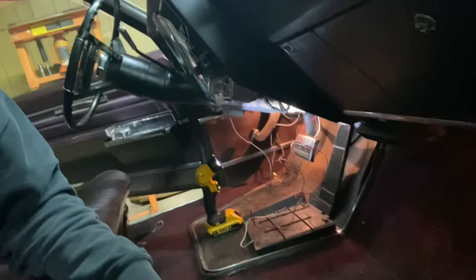All right, it took me two tries to do this because I tried using one of these little clippy doos, which work great sometimes, but they didn't work great for this. So we have a big spider nest of jerry-rig wire down there to jump it, and wow, that hood is massive and it shakes. So we're in business. New neutral safety switch is what I'm really hoping it is.